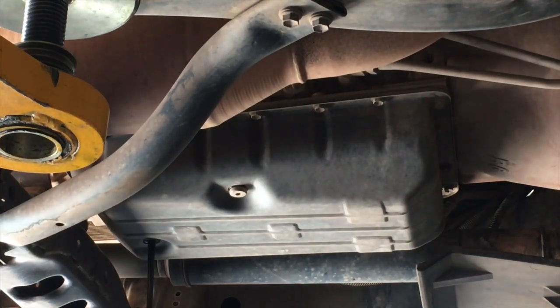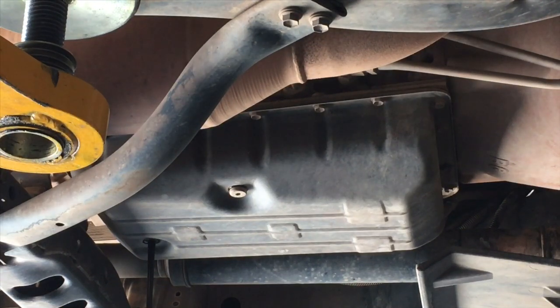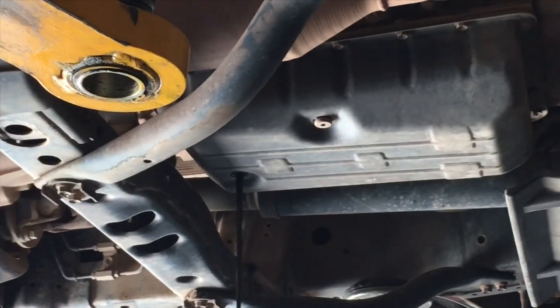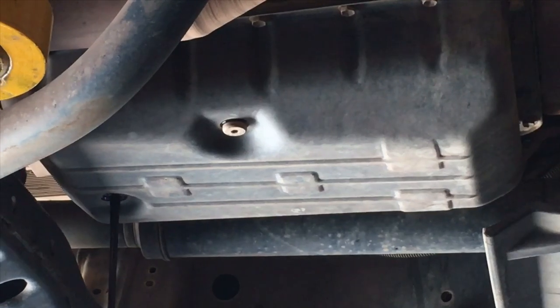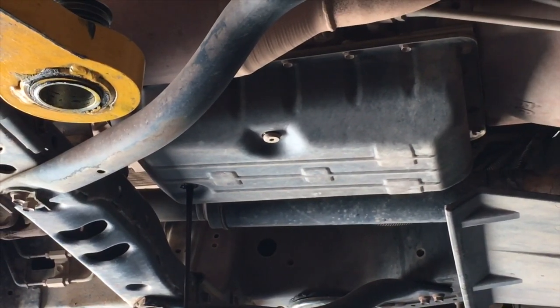There it is — I'll drop it down a little bit so you can see the colour of the oil. It's not black, not the worst we've seen. The oil is draining out. I've got a background I can look at that's yellow and I can see through the oil — as far as I'm concerned, it's normal. It's not really bad, it's brown, just how they are. It's not a problem but it's going to be better. The oil is the lifeblood of the transmission and it's definitely going to protect the transmission components better being clean.